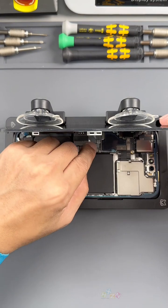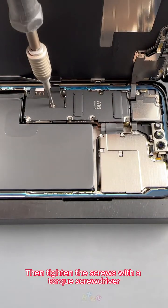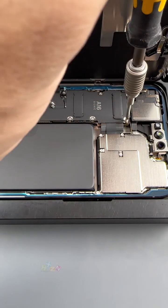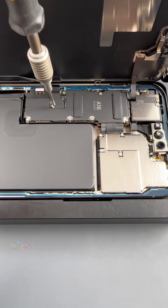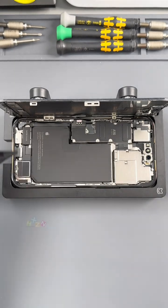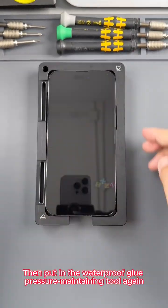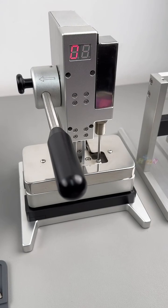Start preparing for installation of the screen. Fasten the screen cable and clean up, then replace the protective cover — first tighten the screws to the fixed position, then tighten with a torque screwdriver. Peel off the last protective film of the waterproof glue, clean it up again, and check to make sure there is no problem before snapping the screen. Then put in the waterproof glue pressure-maintaining tool again and hold pressure for 30 seconds at 75 kilograms average pressure. Pressure holding completed.